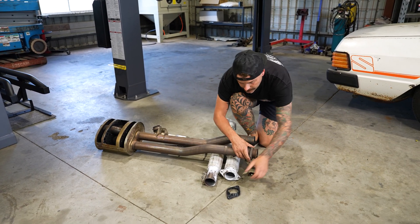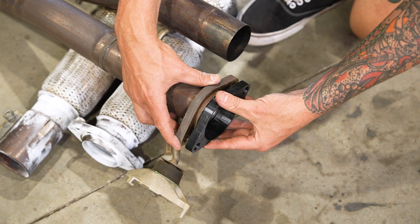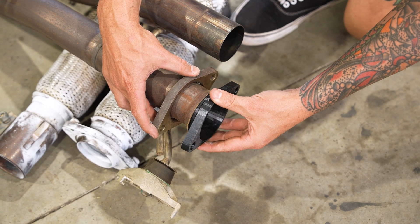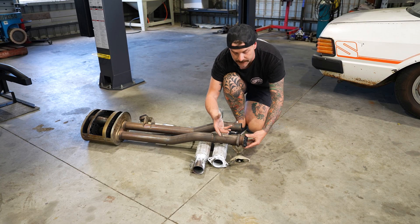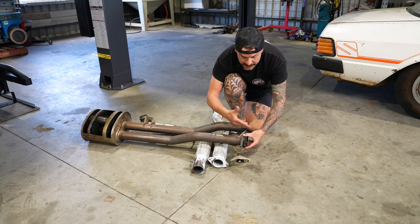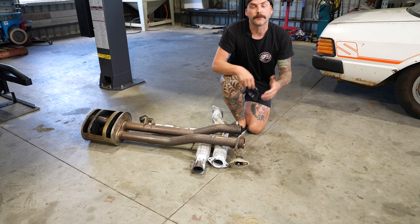From factory, that goes in there. You can see that's a really nice fit. Because of the taper, there will be no exhaust gas leak or anything like that. But with this style, it also allows some movement and flexion in the exhaust. So that's how that'll meet up. Now that we know that's good, we can send that one away to be machined. Let's get the car down and we'll check the pipes in the engine bay.